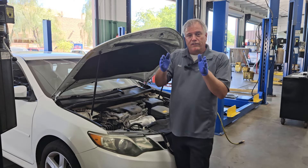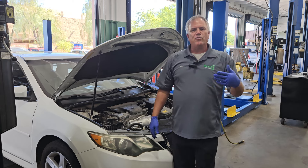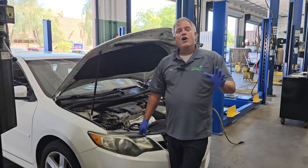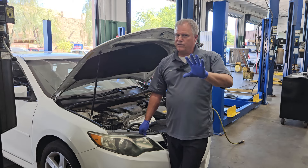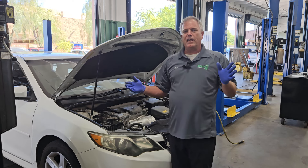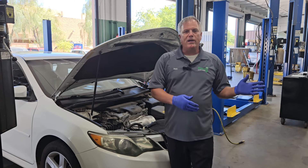So if we release those brakes a little bit, then we can actually turn in that emergency situation. When the ABS light is on, it means the ABS system is disabled. Your non-ABS normal brakes function normally, unless you feel something else and unless the red brake light is on. But if it's just the ABS light, it means there's something in the ABS system and the other brakes are okay.